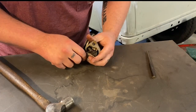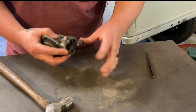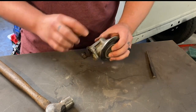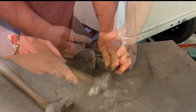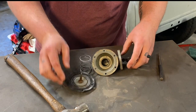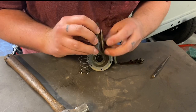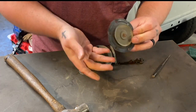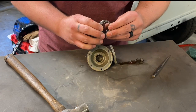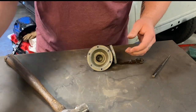I'm going to pop this out and pop that spring out — that releases some tension. Then I'm going to hit this pin out with a punch. This pin is holding the pump arm in, and once I can move the arm enough I can detach it from the plunger. When the pin came out I got lucky and it detached from the plunger so everything can come out and get cleaned. This is trash — there are actually cracks all the way around it, so there's a chance it wasn't working very well. The old spring can sometimes be repurposed as a horn spring on early Fords.